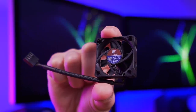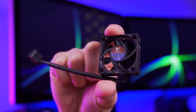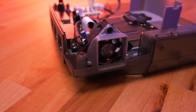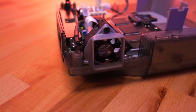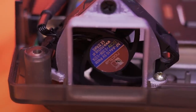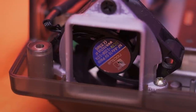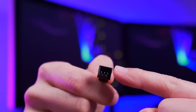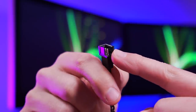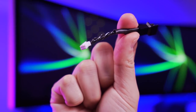The next thing we'll be installing is the Noctua fan mod. This actually has two benefits. The first is that it increases airflow, which improves cooling performance, and secondly — and I would argue more importantly — it makes the Dreamcast whisper quiet. The Dreamcast is notorious for having a very noisy fan, and this mod takes care of that. I bought this fan kit from LaserBear Industries and it came with a custom conversion cable that allows you to plug it in. It's a really great kit and I highly recommend it.